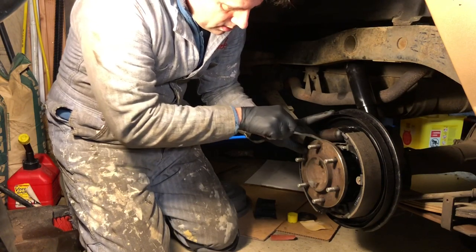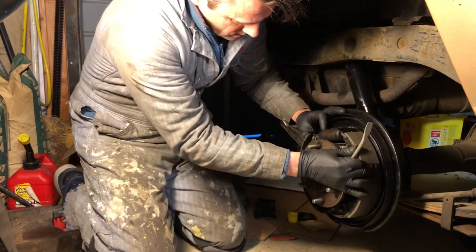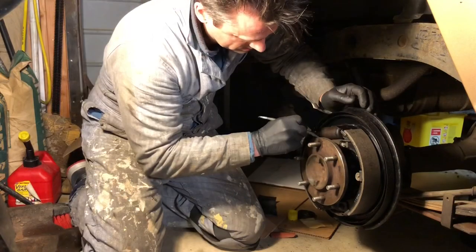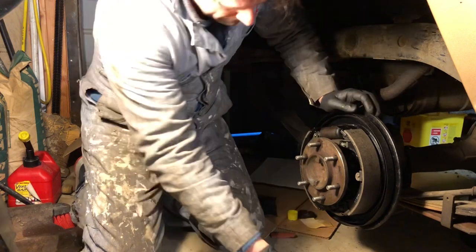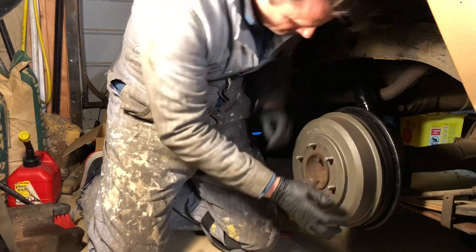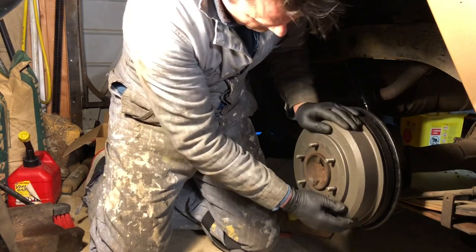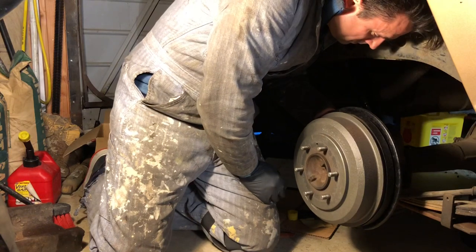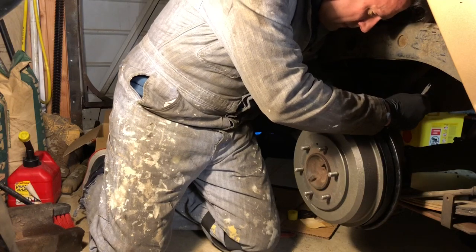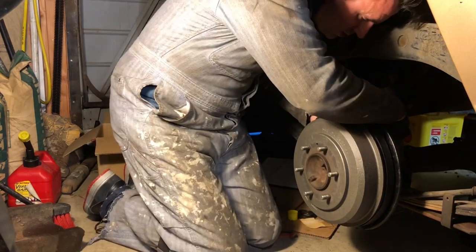And you'll do your rough adjustment from the outside like I'm doing now. However, you'll do your fine adjustment from the back. There's a rubber stopper and a window. Take this little rubber stopper out and put your spoon back here and toggle that star wheel.